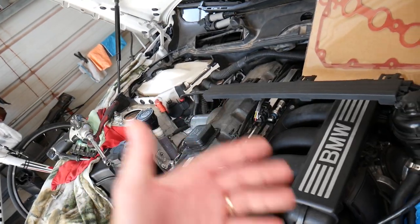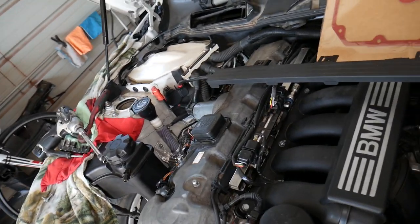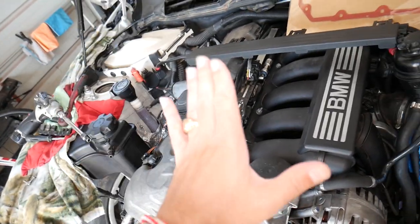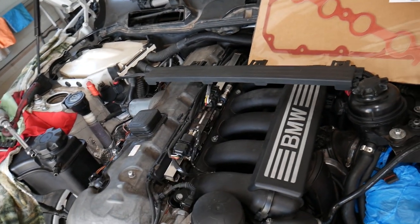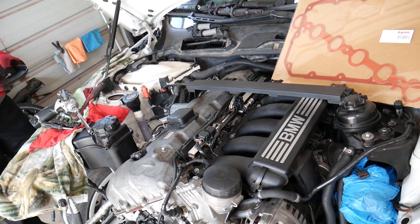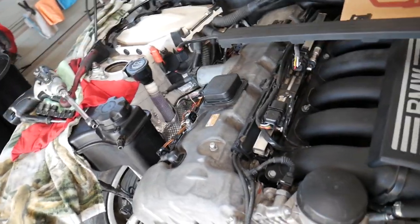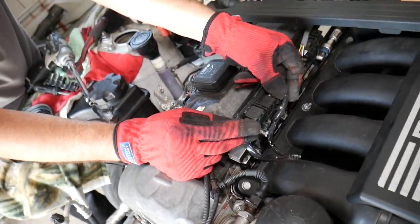With the battery connected, the fuel pump can detect low fuel pressure or activate on its own, and if the fuel line is disconnected you'll spray fuel everywhere. On these modern cars it really matters which battery terminal you disconnect first — we did it the wrong way once and it cost $2,000. I'll put a link to a video explaining that in the description below. Now we have the battery disconnected and gloves on — I recommend rubber gloves so you don't touch gasoline.